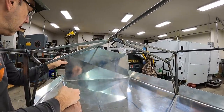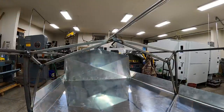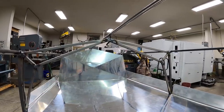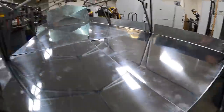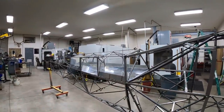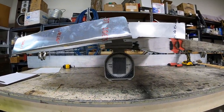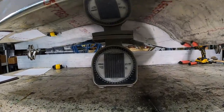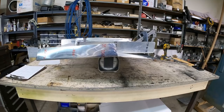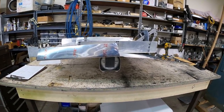So it's all said and done. That part will go in there like that, and now we have an area that's good for lightweight stuff. I'm going to pull it out and weigh it. That upper baggage area weighs four pounds, right at four pounds. I'm guessing by the time I get my reinforcement channel, powder coating, nut plates, and screws, it'll probably be five pounds, maybe five and a quarter, five and a half.